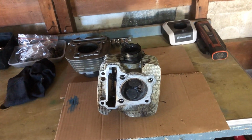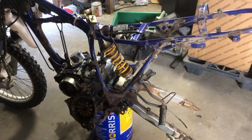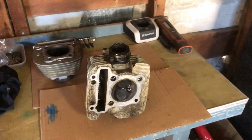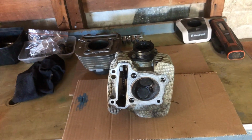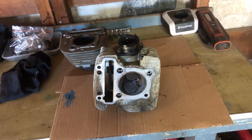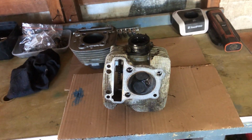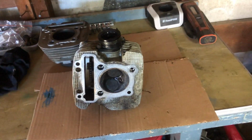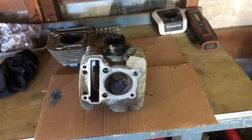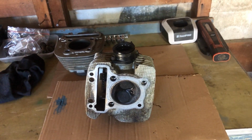So I've got my XT225 valve head off here. Just a wee project I'm doing over here on the XT225. We've got it removed as there was a tapping noise. I removed the tappet cover in the hopes we could just get away with adjusting the valves, and it turned out the intake valve was mushroomed and was about to push through, so hence we've removed the head, we've pulled the motor apart, we've checked everything, the crank and etc is all good, the piston's still sweet. We've just got valves that need replacing.